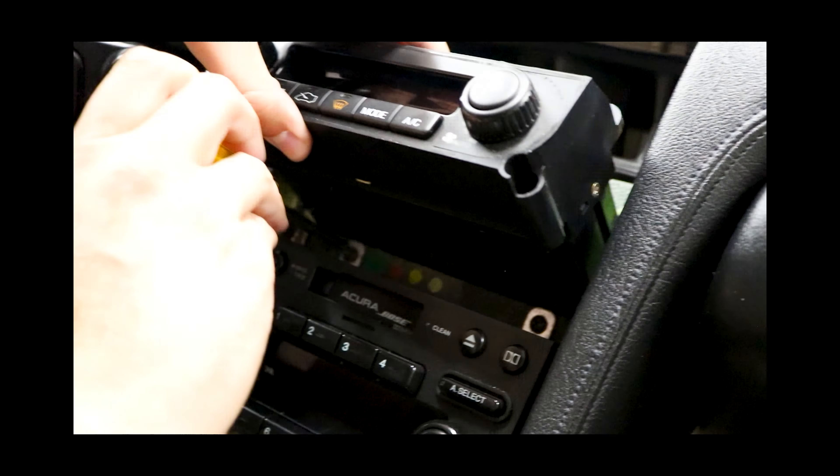Now let's talk about installation. We're going to turn around the new unit, and the same way that you disconnected your radio connector, you just plug this up just like a regular OEM radio. Talk about plug and play — that is amazing. Now the rest of the cords and wires back here are really going to be up to preference. We have a USB cord that came with the radio, and Mr. Willman added an extension to another USB connector, which is awesome. We also have an antenna connector, a mic connector, and an aux port connector.